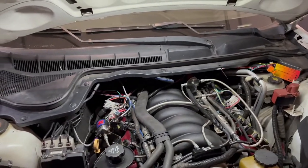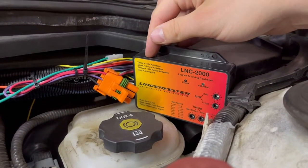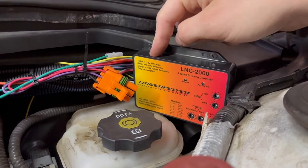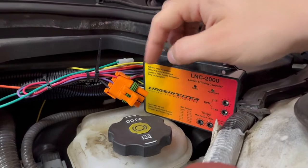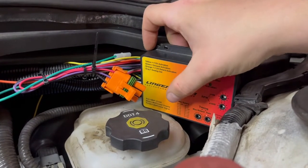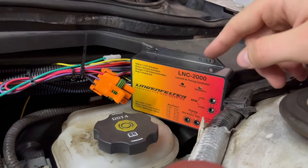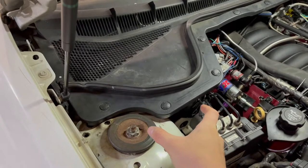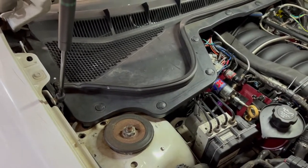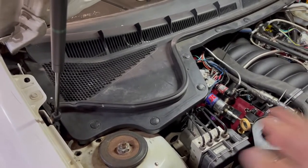Right here at the end I'm just going to walk through what I did with some of the wiring and where it runs. The LNC — this yellow wire we'll climb under the dash to show where it went — I used the yellow for the two-step or launch control. We ended up not using the green, we used the orange; the orange one went to the WinMax. We did not use the gray or any of the map stuff. I had a hard time on the 275s with the stock converter getting launch control to work — it wants to spin the tires anything north of about 1600 RPM, but a converter will help with that. For the relays, I ended up jumping the fuel and nitrous into one relay and there's a purge, so now there's only two.